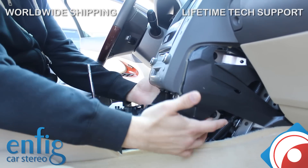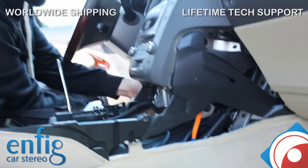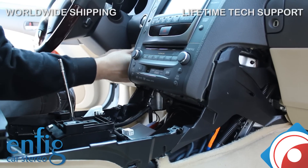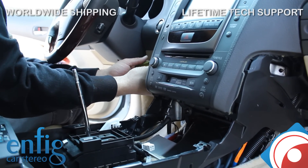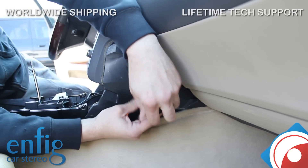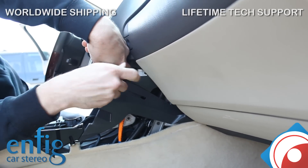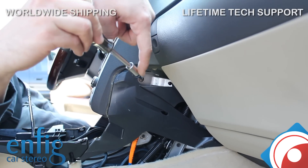Now the next part of the install — the radio is held in by four bolts. You've got two here and two up top. This is actually a 10-millimeter bolt, so just use a 10-millimeter socket. You might need a ratchet to break them — they're a little tight. A little trick: once you get the bolt out, put your finger next to it to keep it from dropping. If you guide it out with your finger, it won't drop until you want it to.